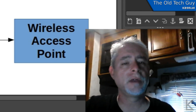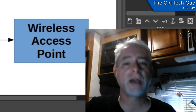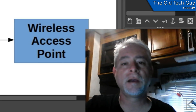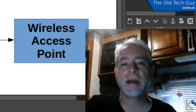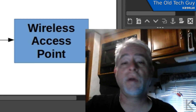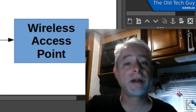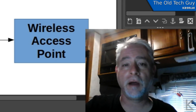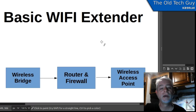If you have a site you log into with a username and password that does not use HTTPS, complain to them — because everything you send is in the clear, regular text. Anybody on the network sniffing traffic will be able to read your username and password. It's relatively rare but it does happen, especially at hotels, airports, maybe even a Walmart. Any big public Wi-Fi network is a potential target — hackers can sniff packets, poke at your computer, or browse public shares. So the router and firewall centerpiece on some extenders is quite important.